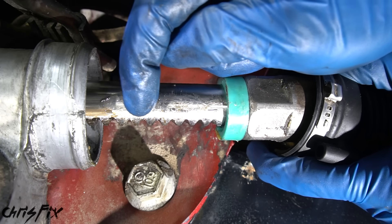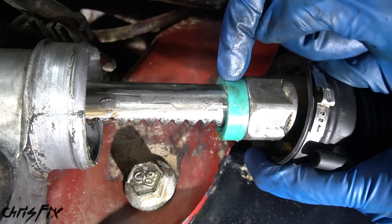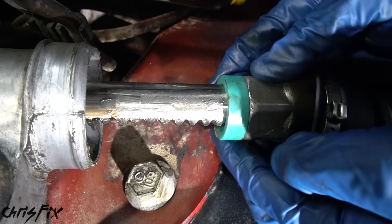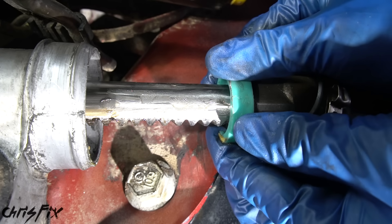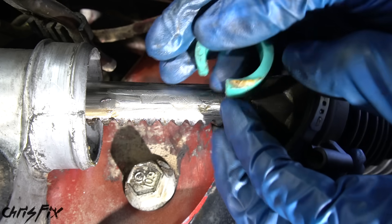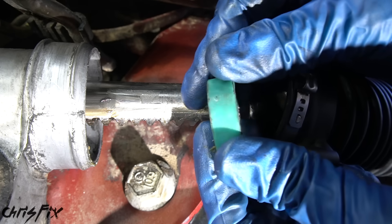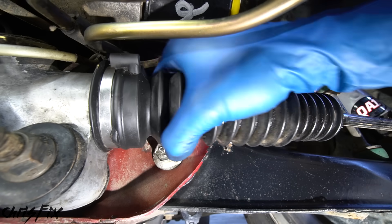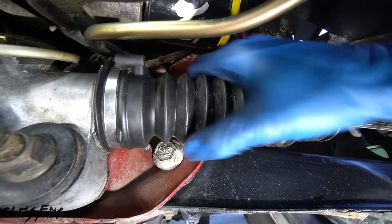You can actually see the teeth on the power steering rack which allow it to move back and forth. Then we have our rack limiter, and then the inner tie rod. To get the rack limiter out — it's just a little C-shaped spacer — it should just pop right out. Be careful not to break it. And that's all it takes to remove the rack limiter. Simply push the boot right back on, making sure you push it all the way in so it seats up against the power steering rack.